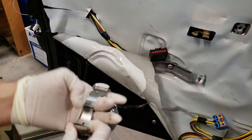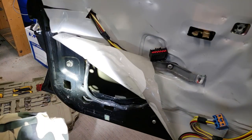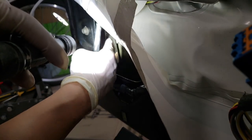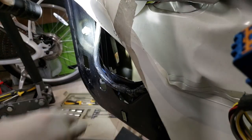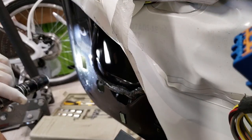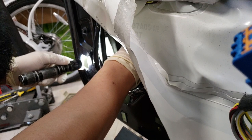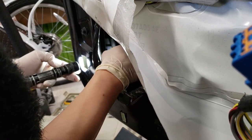Your only access hole is going to be right in here — remove any watches or jewelry before you reach in. Hopefully you can see inside there — that's our door lock actuator. Just like I was saying, there is a full body boot that goes over both the moving section of the locking rod as well as the actual body of the actuator itself. The first step is disconnecting the connector — pretty easy, just reach in there, pull back on the tab, and there's your connector. Then grab your flathead screwdriver and get underneath the top part of the bracket.